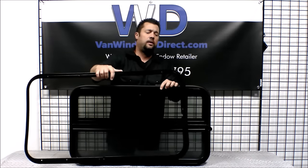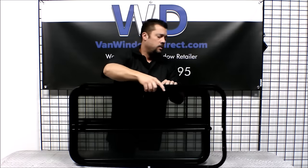The aluminum frame is going to go through the hole you cut and attach to your trim ring. The trim ring, as you can see, has got a bunch of holes all the way around. Before you do your final installation onto the van, you'll want to put your trim ring onto the aluminum frame of the window and put pilot holes all the way around. This will make it much easier when tightening up the window. Make sure you don't round the heads of the screws.